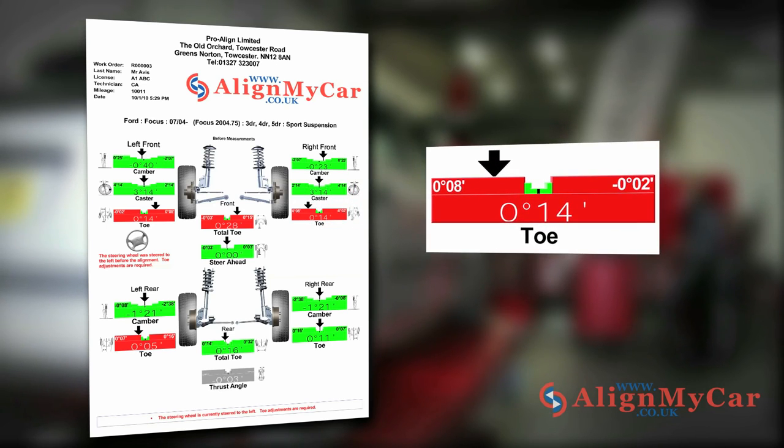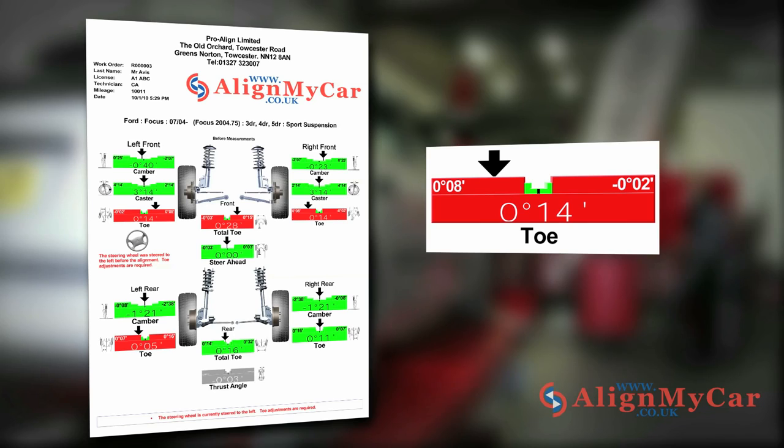The set of numbers in each top corner represent the from and to motor manufacturer tolerance figures for the particular model of car, with the ideal in-alignment setting halfway between the two tolerances. If the angle is out of alignment, the arrow will be off-centre, over to one side or the other. The central figure shown is the actual measured figure, which is most often presented in degrees and minutes.